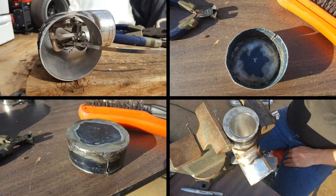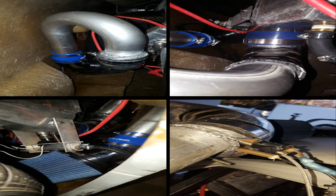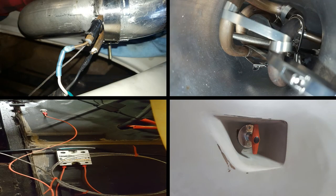One pipe is for the preheater, and the smaller size actually goes to the throttle body. A single 50-millimeter is what's installed now. These are more images of the completed piping — it comes in off of the intercooler and goes towards the throttle body. You can see where the heating element exits the plumbing, along with the K-type thermocouple cable where it exits as well. There is a large disconnect for the battery lead into the inverter, as well as a small relay that I use with the Arduino to switch power onto the box to warm it and maintain a particular temperature.